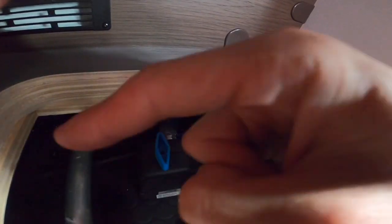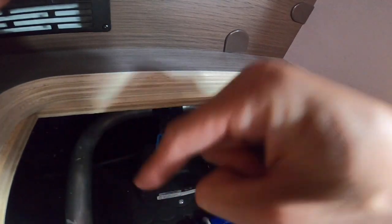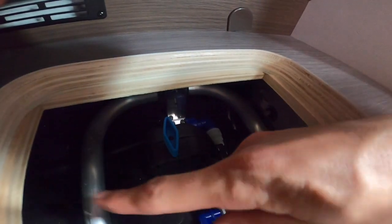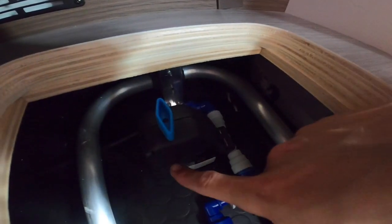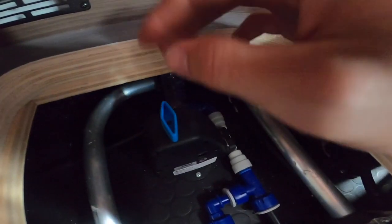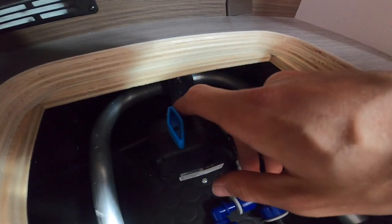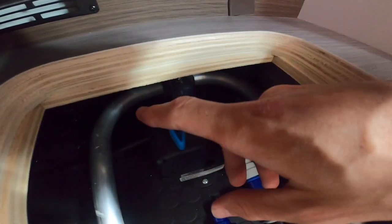You'll get automatic cold water as it's drawn from the main tank underneath the chassis. Go to the hot side, it will cough, splutter, make all sorts of noises because it's drawn in from underneath the chassis into the boiler, which is pushing all the air out. And then what you want to do is pressurise one tap, do them all, and then you're good to go.